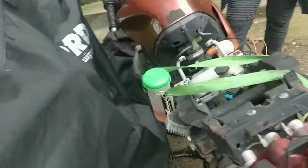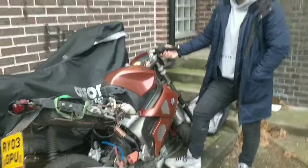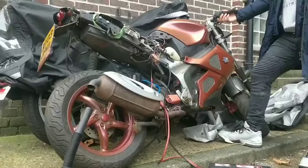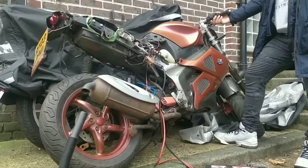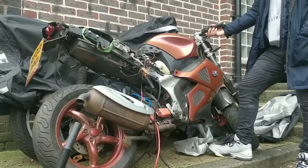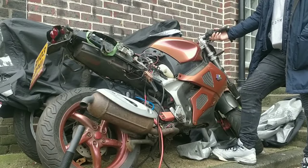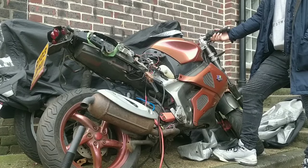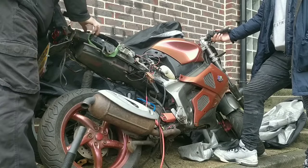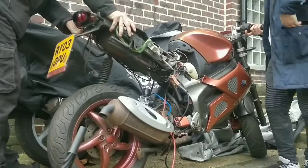Alright, guys, so we got some pre-mix in there. You see the red fuel? It's not as mixed as last time. We've got spark. We may have compression. We actually don't know about that. I'm going to play with the intake because it will be having too much air at the moment. There, it could start up. It shouldn't, really. Maybe. It has got spark, though, so we just don't know. We can't rev it. We haven't set up the throttle, so we can't rev it. But we'll hear something, maybe. I genuinely don't know. We don't necessarily need to stand it up, but it's nice.